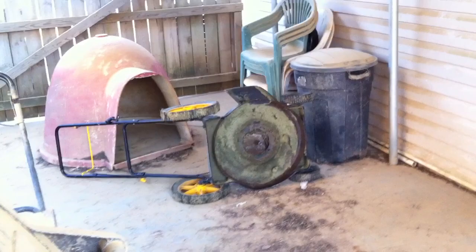I'm going to finish that up, get this blade sharpened, and then we'll go to the next step of maintaining our push mower. We got our lawnmower blade on both sides, nice and sharp. Now I need to focus on the underside of this nasty mower. We've got caked-on grass, dirt, and mud. I just need to get a putty knife or something equivalent to scrape it all off.